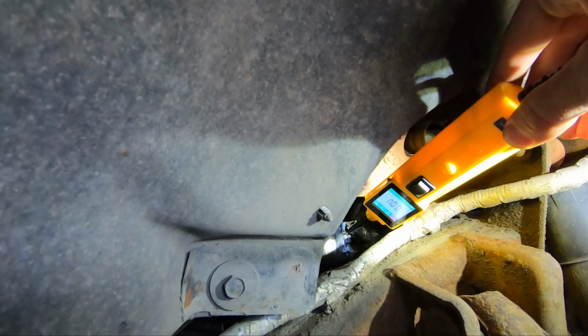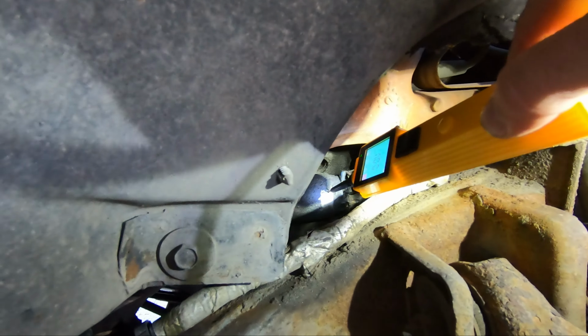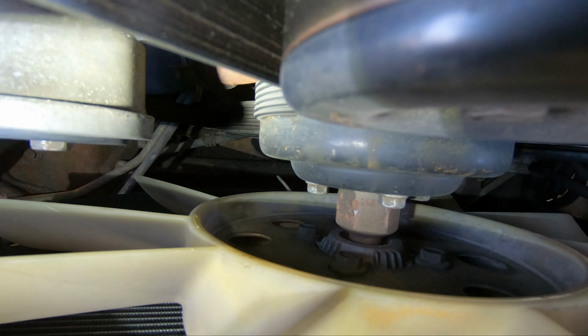Okay, we got a ground on the signal wire right now. That's good. That's power. Battery voltage on the body of the starter is grounded, so all we've got to do is try and start it with this resting on the signal wire and take a video of that. See if I can hear that from there. Alright, just double checking that the motor turns down there, so I'm spinning the alternator. That's a good way to tell if something like an alternator can spin it, then it's nice and loose, and it did, so it's that starter.